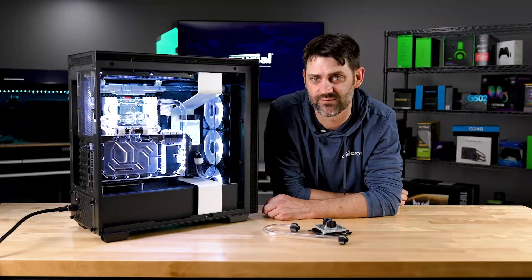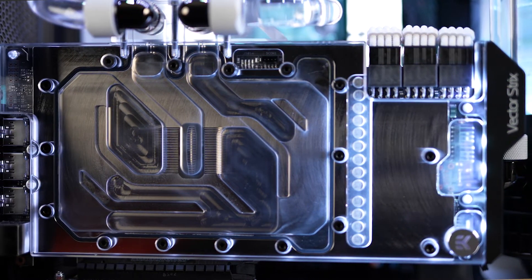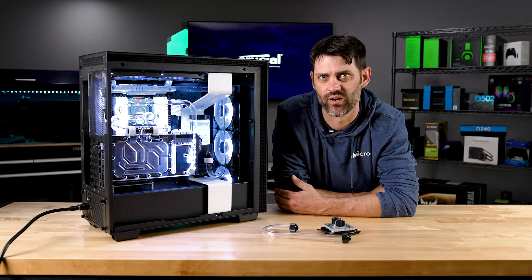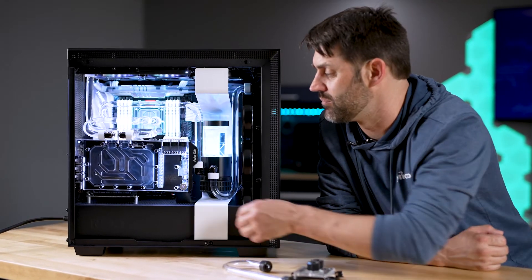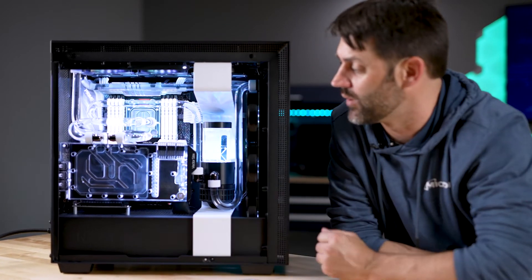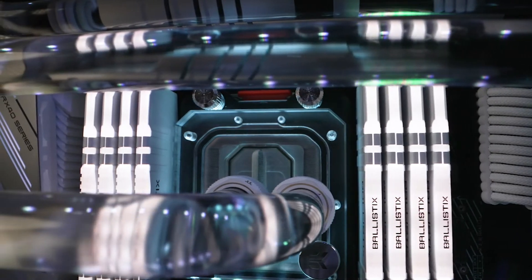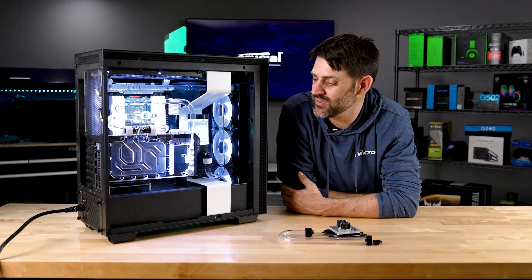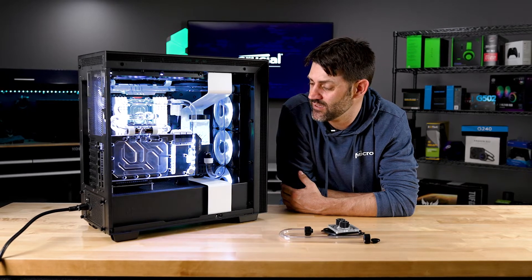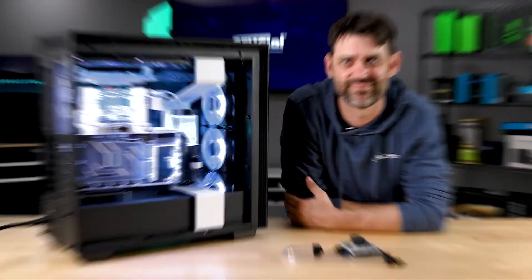Painting the bar white really tied everything together and I love how it turned out. For the GPU we did end up using Austin's RTX 3090, covered it with water blocks to keep it cool. I had to do some custom work — the case supports a vertical GPU, but there's no support underneath it, so we made custom brackets at the bottom using tubing that runs up to the riser card to support the weight. For cooling, we ended up with two 360 radiators, plenty of tubing, EK blocks and pump throughout. The 1000-watt EVGA PSU — we'll see if it can support the load.